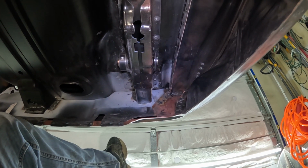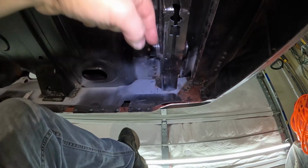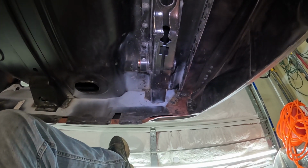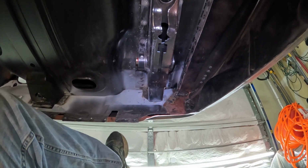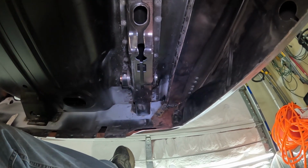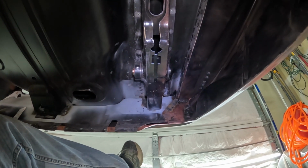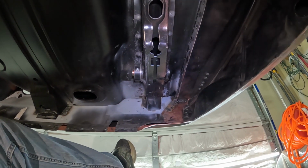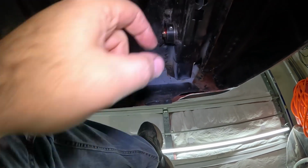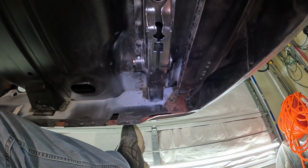What I ended up doing was, I took a cylinder brake honing tool, reamed the inside out of the frame itself, and cleaned all the paint off on the inside there, made it nice and smooth, because maybe I thought when they welded that tubing in on the frame rail that came from Taiwan, maybe they warped the inside of the tube itself. And there was some warpage to it. I'm not gonna lie, that wasn't the main problem, but the main problem was the bushings themselves. They were just too freaking big for the hole. Sometimes that's not a problem for some things, but it's a problem for this.